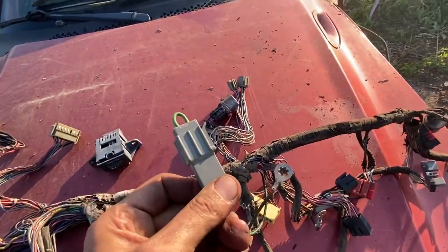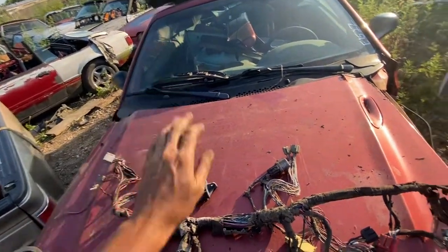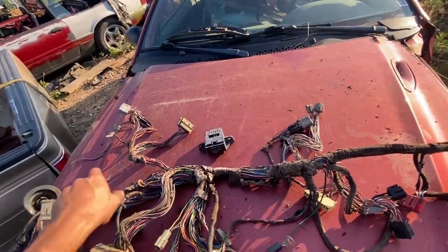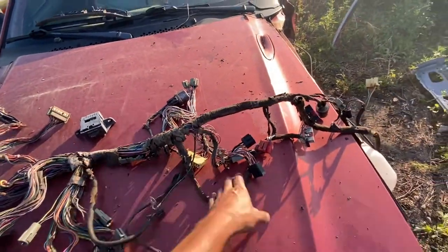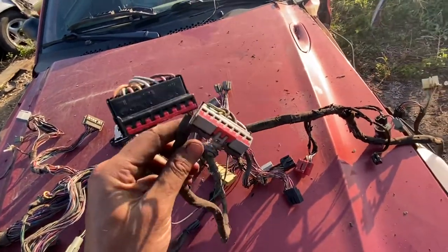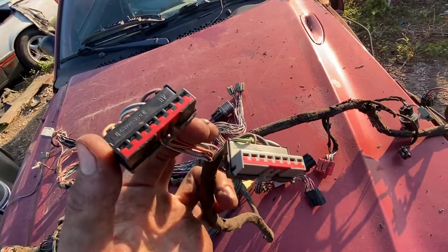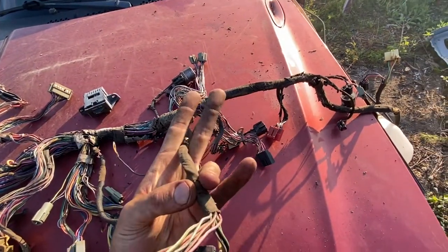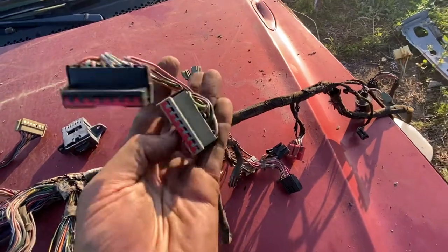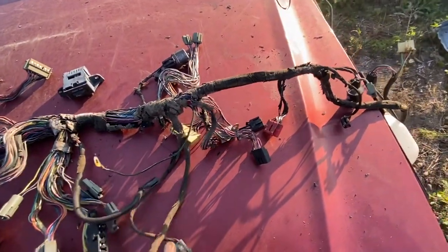Here's that second connector I mentioned earlier about the pedal assembly — this is for cruise control to disengage. When you're on the expressway and you push the clutch in, it will disengage your cruise control. For automatics, they have these loops in here; if you're going stick shift, you'll want to take this one out and plug it in, along with the other red one I showed earlier. Where are my radio wires — I'm so proud of these radio wires. Ken, I thought there were maybe an issue in the radio area when I showed you last week — I was mistaken. These are unmolested, perfect, never-tapped-into radio wires. I'm so proud to show these. The easiest place to put an aftermarket radio in is to snip it here; this one, they never actually did an aftermarket radio. If you ever choose to do that, please buy the installation kit so as not to hack up this beauty — or ask me, I've got the male ends for sale online.